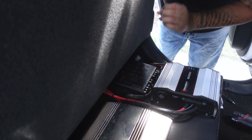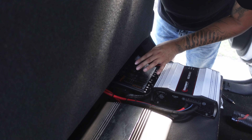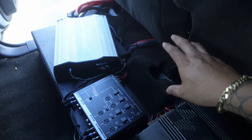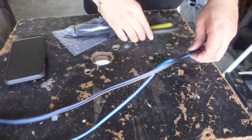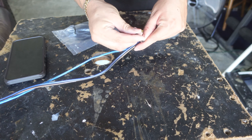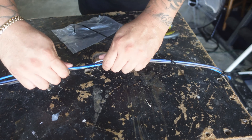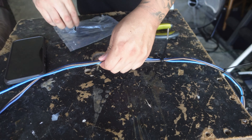I'm actually going to leave this crossover here because I just tried to pull it out and the wires are basically cut to fit that spot. We're eventually putting the stunt wall back in place so we'll leave it there for later. I'm going to find a way to put the epicenter somewhere in that area, jump power from this crossover, and run a small route of RCAs to get it connected. I'm going to use a thicker speaker wire to power the epicenter and join the wires with zip ties — before I used electrical tape but that makes such a mess. Zip ties are faster, neater, and cheaper.